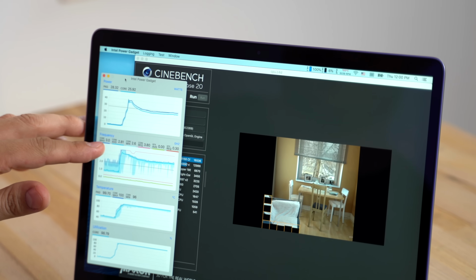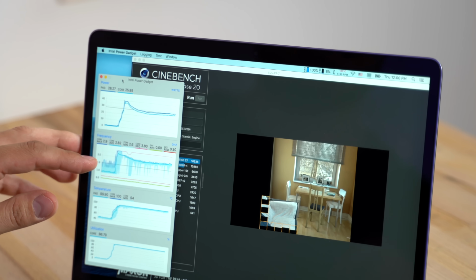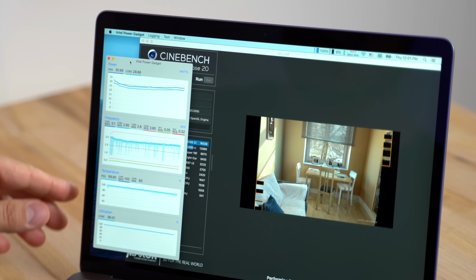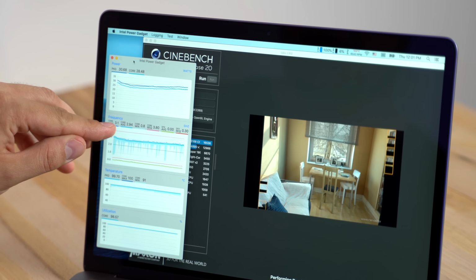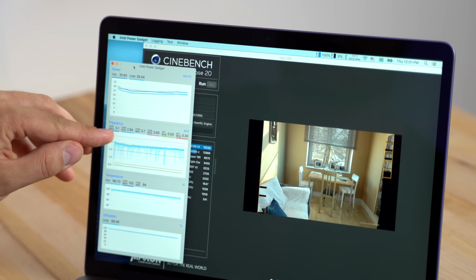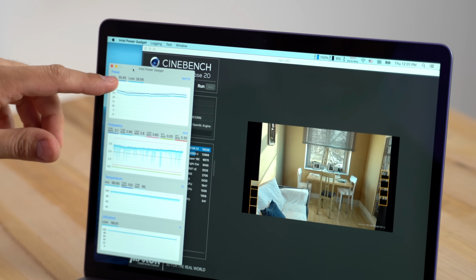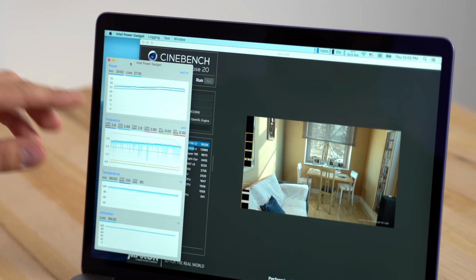Apple, oh, 3 gigahertz right there. Apple's definitely trying to get as much performance out of this machine as they possibly can. I'm excited to see the internals, which we're gonna open up in our comparison to the base model if you guys wanna see that. We're about 90% done. It's very interesting that every once in a while it actually is going up to 3.1 gigahertz, then down to 3. So as the fans kicked up, it's allowing it to run faster. The wattage is now almost 31 watts. So don't be fooled that 2 gigahertz i5, when you're pushing it, is running at 3.0, 3.1, and right now we're about to get done here.